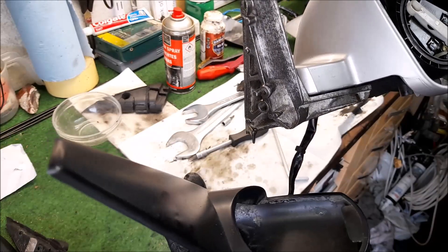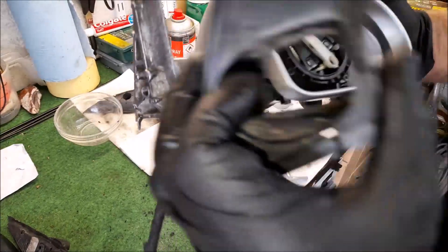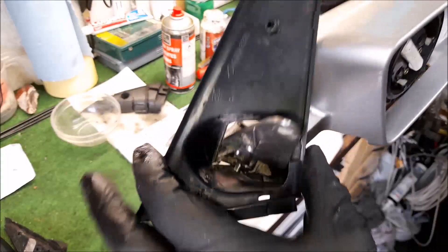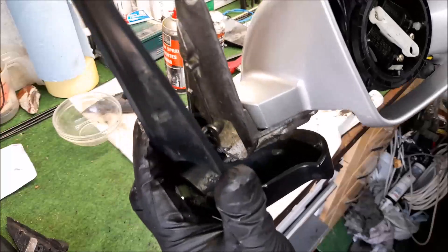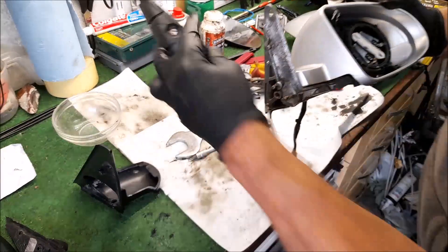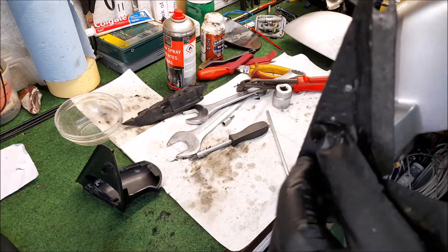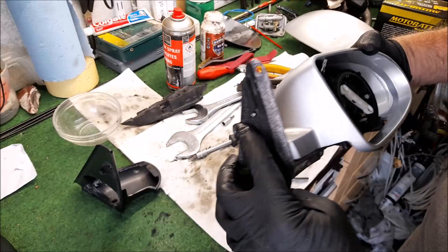Screw number six in situ. We have two little cables to heat our heating pad up. Once I've adhered that to there, you basically pop little thingies on and snap that into place very gently — always use the palm of your hand on the centre of the glass where this circle is. Palm of hand, push it until it clicks. I've yet to glue that down so I'll do that presently. And then... that aluminium piece should have gone through there first! Oh no — I'm going to have to undo that springing clip again plus all six screws and start again.